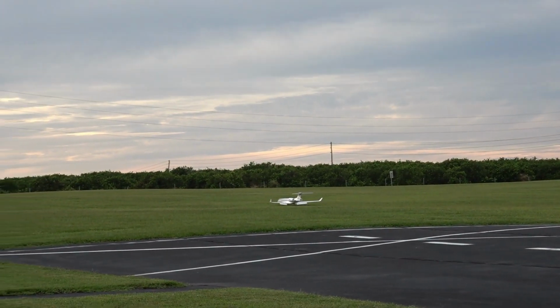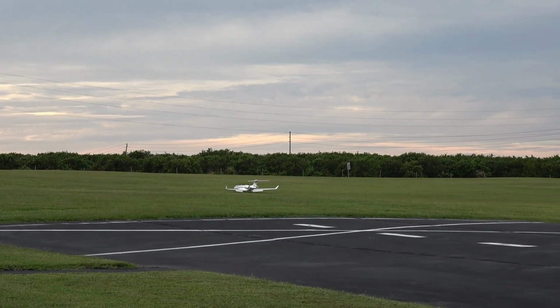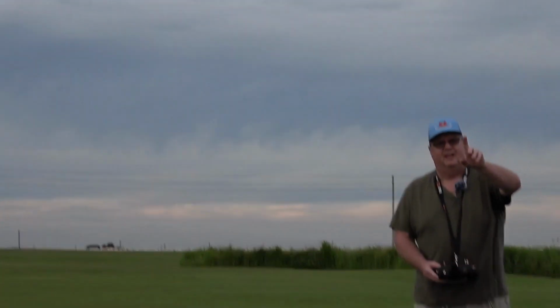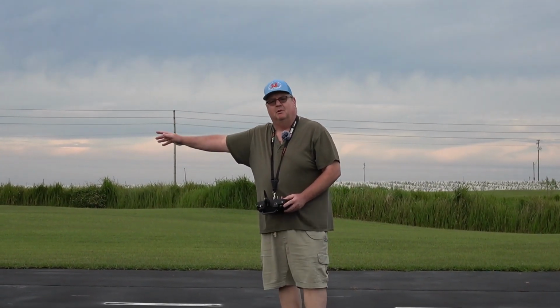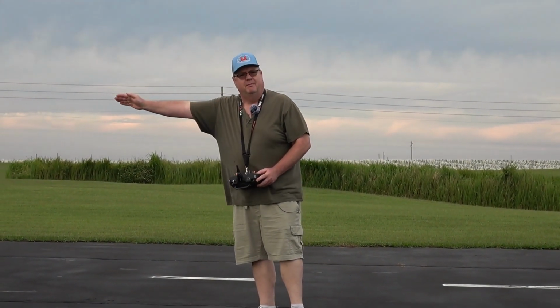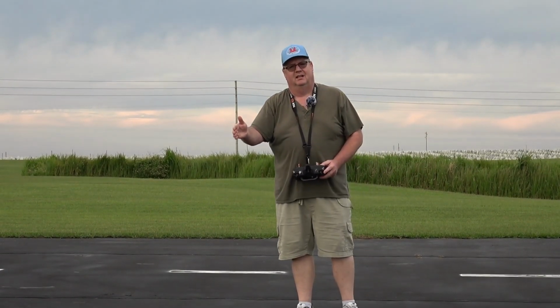There we go. Now, if you notice, folks, you're going to have a tendency as a pilot, when you're coming in like that and you get that bounce, you're thinking, kill it real quick and put it down. No, give yourself some throttle, because if I killed it then, I'm going to have a terrible bounce and probably tumble the aircraft. So instead, I gave her some more throttle, pushed back out of it, and basically got 2 landings for the price of 1.